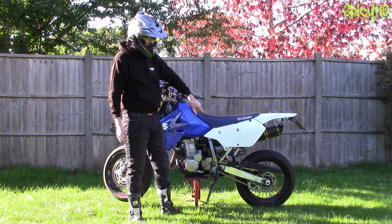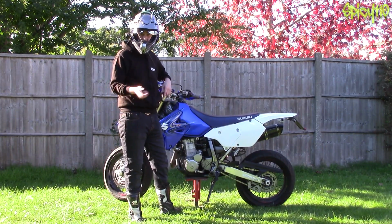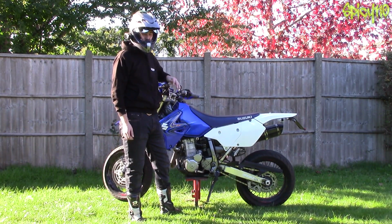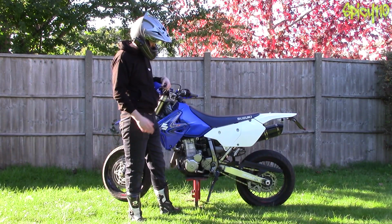It is known for chains that snap to, when they come around this way, they whip the inside of the engine casings and can actually smash holes into your engine. So you really don't want to mess around with your chain. It should be clean and well lubed, not overly lubed. Again, check out videos for your bike, check out your instruction manual, it's exactly how you do that.